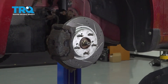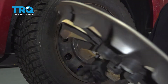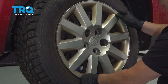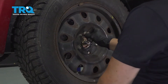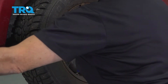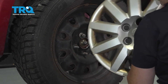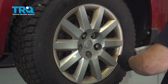Now install the tire. Quick tip about hubcaps — you've got the valve stem where it lines up, but Chrysler has these big two holes. If you line those up, you can put lug nuts on two studs before the hubcap goes on. Mount the tire with a 19-millimeter socket, bottom it out, then take the hubcap, line it up, and it will click right on. Put on the remaining three lug nuts.